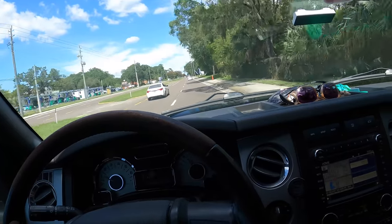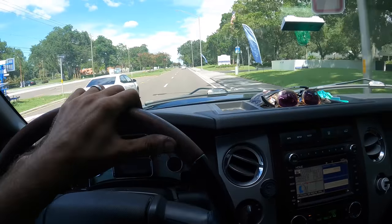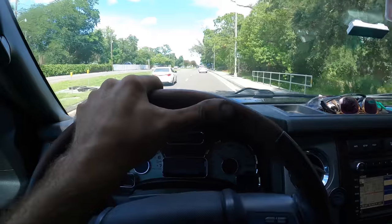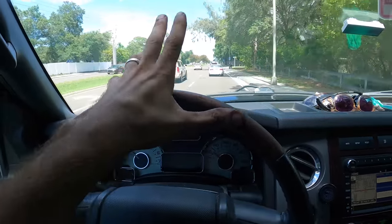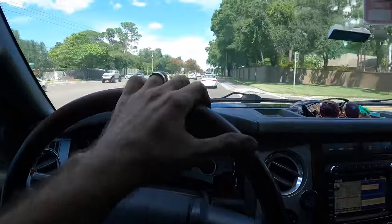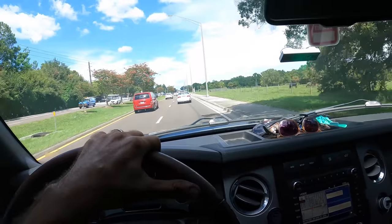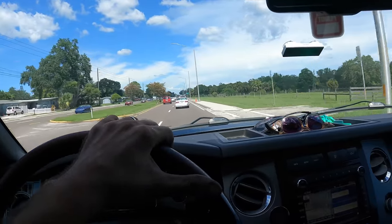Well, since we rotated those tires and did not replace them, I do still hear some of that choppy humming buzzing noise, but I no longer hear it from up here. I do hear it from the back. However, when I do the left and right turn, I do not hear the very loud helicopter noise. You remember earlier from the first video, I think I heard two or maybe even three different noises, and we confirmed wheel bearing noises with the stethoscope. We have eliminated the wheel bearing noises. I do not hear them, but I still do hear those tires singing to us again, and they're in the back, so there's definitely a change, but our guy didn't want to change those tires.